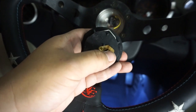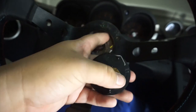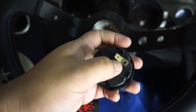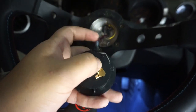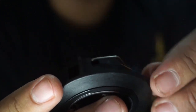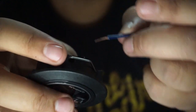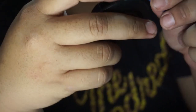Hook the cable up here. When you push the button, this should already be touching a negative, which should be touching on the inside. But if it doesn't make a good connection, the horn is not working, because this one has a dedicated ground and a positive. So I'm going to try to run a connector from this here to one of the wires and see if that makes a difference. I'm going to connect this wire to this prong here, and then connect the end of this wire into the second connection on the quick release. That should give me a complete circuit, so when I push the button for the horn, it should work.